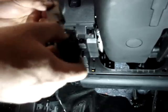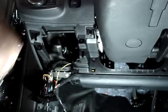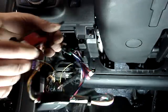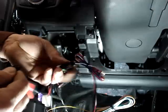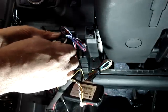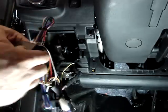The antenna kit's going to come with an antenna, a cable, and 2 single button remotes. Okay, the first thing we're going to want to do is locate the coupler in the wiring harness if you have the model with the extended range antenna. We're going to take the 4-pin plug with a clip on it, and plug it into the open plug on the coupler. At this point, the long-range antenna is connected. We're going to advance to programming the long-range antenna.